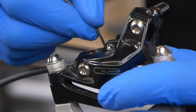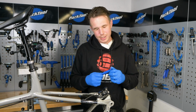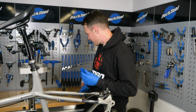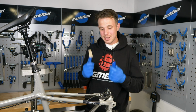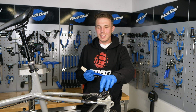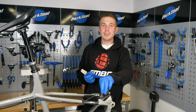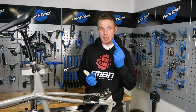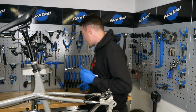And then we're going to get a plastic tyre lever. Now, you'll often see people use metal tyre levers or pad spacers on pistons. It's something I'm loath to do, because these can sometimes be quite brittle metal and they can just shatter. I'd rather not run the risk and use a plastic tyre lever personally.